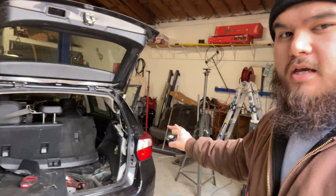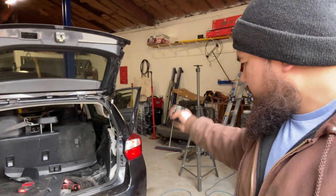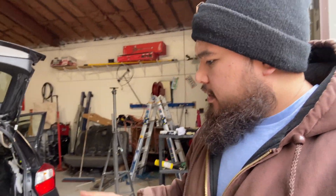This car came back from the body shop. It was actually hit on the driver's side quarter panel. So the car came back from the body shop with a TPMS light on. I went through all my diagnostic testing. The first thing you do is go through each and every tire, make sure you're inflated to the right pressure. Then I took my Autel scan tool — it's an OBD scan tool that clears codes — plugged that in and cleared whatever codes were on there. But I was getting one code back, which was saying failed communication with TPMS module.